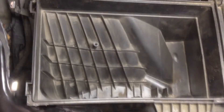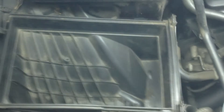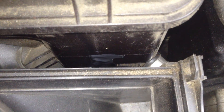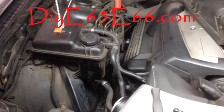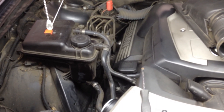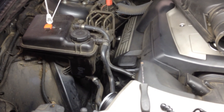Here's a shot of the box back in — there are the two Phillips heads I put back in, and it just slides straight down. You've got to pull that little hose out of the way a little bit, that corner goes in, and then you just plop your air filter back on, close the box, seal it up, and you're good. In the back side right here was my leak right there, so we're looking good. I hope you enjoyed the video. Please subscribe and head on over to DIYE65E66.com where you can find all these videos, tips and tricks. Drop me a comment and let me know what you guys think. Alright guys, take care, bye bye.